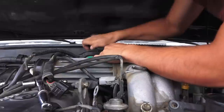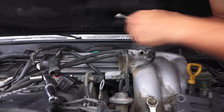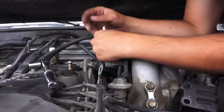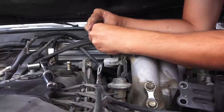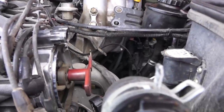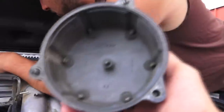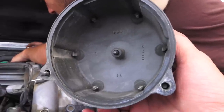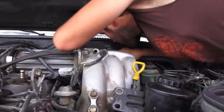We'll use this time to do some regular maintenance. We'll replace the spark plugs and spark plug wires - I don't know when any of this stuff was changed. The previous owner was taking care of this vehicle, decent enough. We also intend to replace the rotor and the distributor cap. Looking at the distributor cap, it doesn't show too much wear, but it's not very expensive and it's a good time to replace both, especially as we are preparing this vehicle for a long journey.